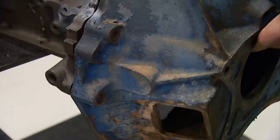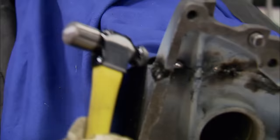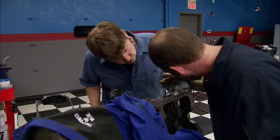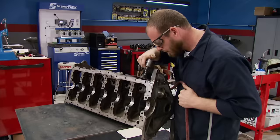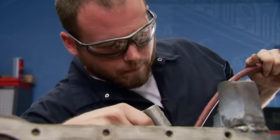Keep in mind: if too much heat is introduced and it cools rapidly, the metal hardens, making it extremely difficult to tap or drill. As long as she holds together, that's all we need. That's what I love about building engines — the industry keeps cranking out new technology and the aftermarket's right on their heels, but sometimes you get to learn an old skill from the past.